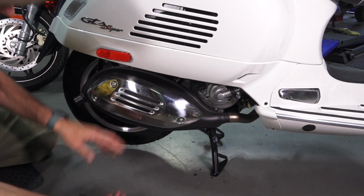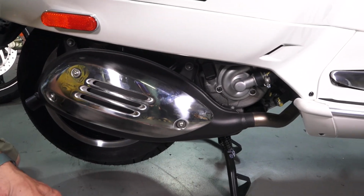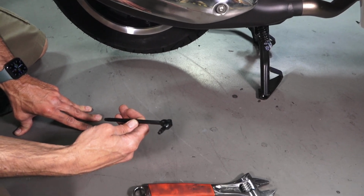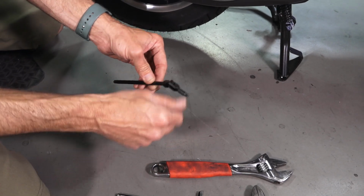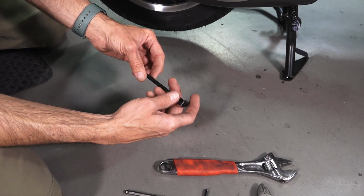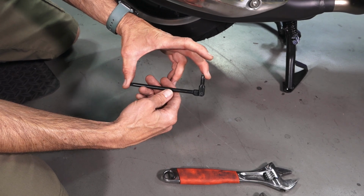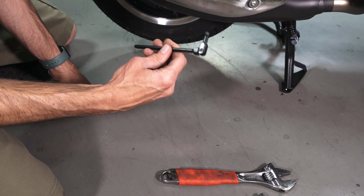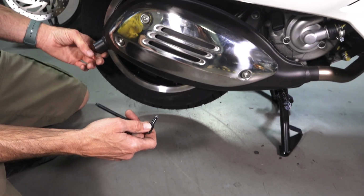Next, you have a set of 3 fasteners that hold your muffler in place. This is a little bit trickier to find. This is a T40 wrench. You can find them that look similar to the Allen style wrenches, or you can find a deluxe one like this. I mean, this is a fancy Blue Point or Snap-on one. But I have seen full assortments with a T40 wrench. Alternatively, you can have a ratchet on you. But I really like this little tool. It's really compact and lightweight and would be perfect for a trip.